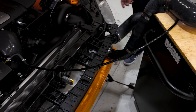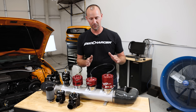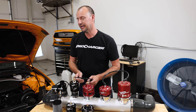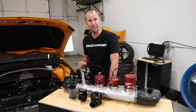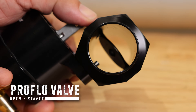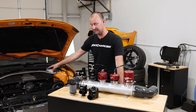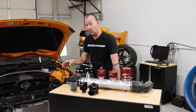It blows through the tube before it goes back down and returns into the intercooler. Now if you've got ADD like I do, you're probably wondering why I have loops on these. Currently I have these looped because that actually locks these valves down in place — the pressure can't go anywhere, it can't open or close. So we start everything with the ProFlow unit on the end that is currently hooked up. This thing flows like none other. When this linkage pulls that throttle blade wide open, the air can just rush out of here, and it doesn't have to change directions like any other valve — it is a straight-through shot just like the throttle body on your car.